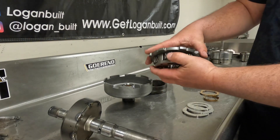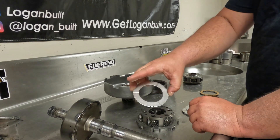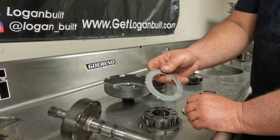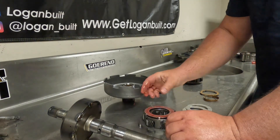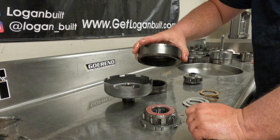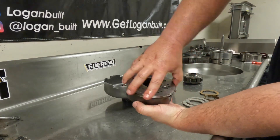You're going to take your low planetary gear set and flip it upside down. This is where you're going to put a thrust washer. The thrust washer has holes that it's going to go into like that, really straightforward. I like to dip these in transmission fluid before I install them, just so they're nice and lubed up when you put them together. Now that I've got the thrust washer on here, I'm going to take the low ring gear and slide it on there like that. Now these two pieces are together and the washer is nice and lubed up.